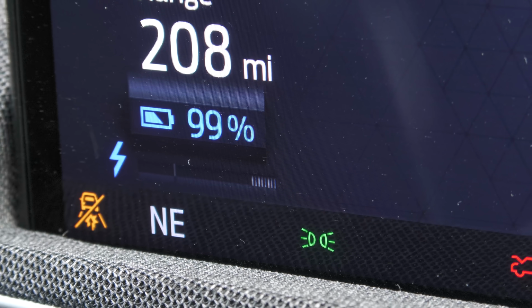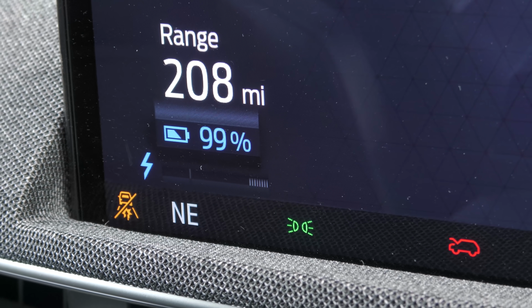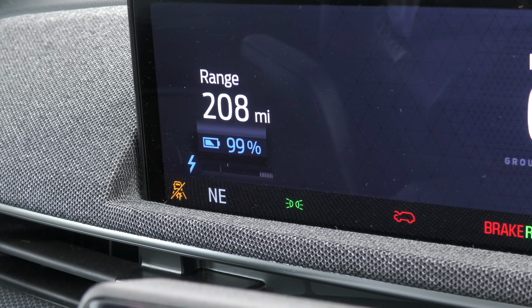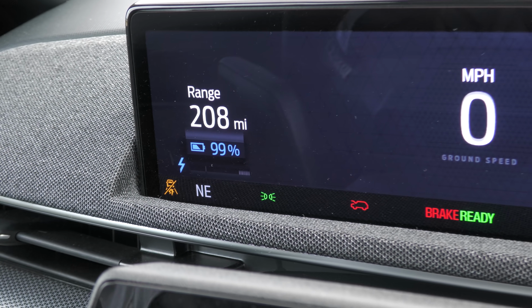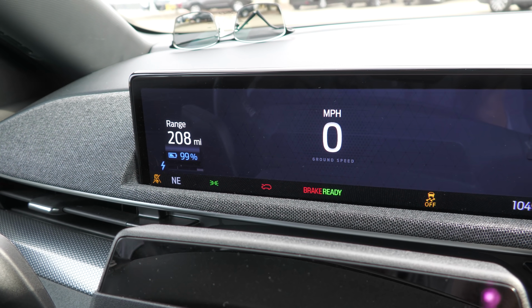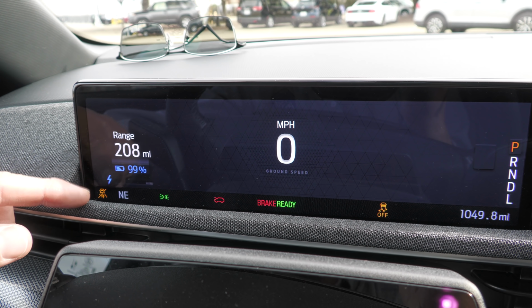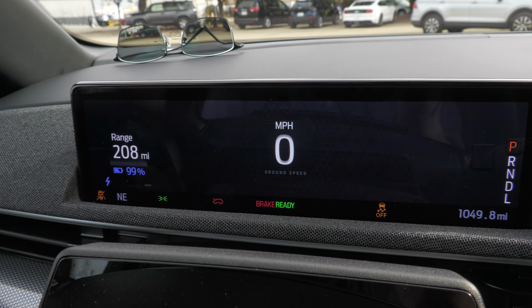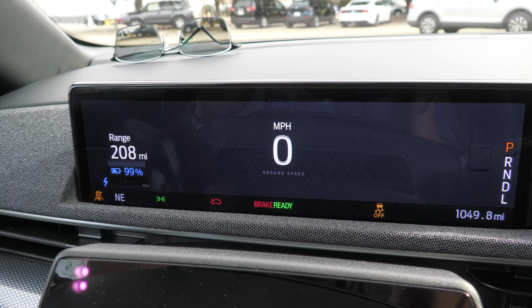When we're in Unbridled Extend, or if you've just been driving the vehicle hard in Unbridled mode, you'll notice that the vehicle will reduce power a little bit. In the rest of the Mach-E lineup, theoretically, this could happen as well if you're driving it hard, but you don't really know exactly how much power has been removed from the equation. When you're in Unbridled Extend, the propulsion sound changes a little bit, the autonomous braking system cancels, we also get reduced traction and stability control, and altered all-wheel drive programming.